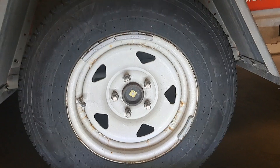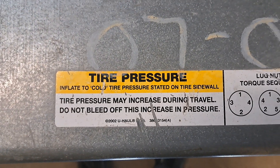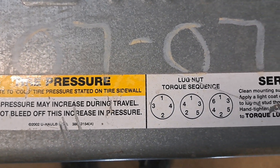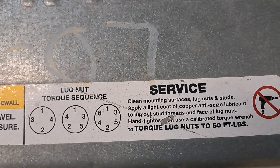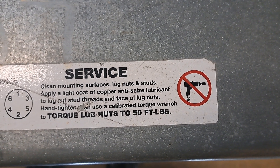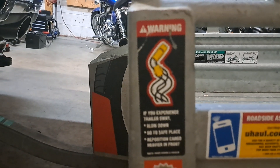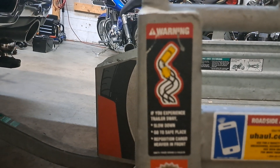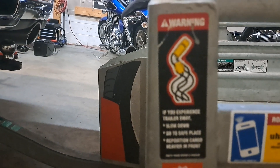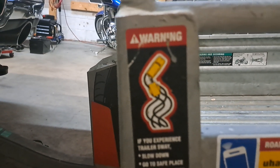There are no brakes on this trailer — we die like real men. Since the trailer doesn't know what kind of tires it might have, it just tells you to inflate them to the cold tire pressure stated on the sidewall. Just don't go over it. Here's how you do all kinds of lug nut sequences, and torque those nuts down to 50 foot-pounds. The warning sticker says: if you experience trailer sway, slow down, go to a safe place, move the cargo around — heavier in front. And when you're leaving, just leave black marks and smoke everywhere. That's what you're looking to do.